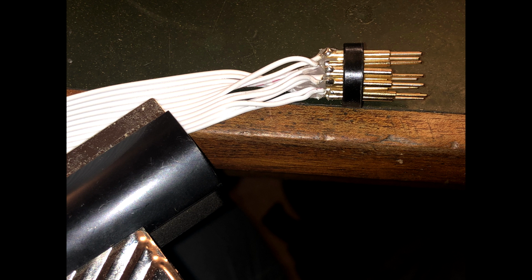I didn't get a picture, but if you look really closely you should find at least 2 pins which don't have wires attached to them. You'll need one of those to replace your broken one, and you can simply take hold of it with some tweezers and draw it out of the plug in the direction that the pins point. Hot glue might be holding it in, but you'll see what I mean when you do it.